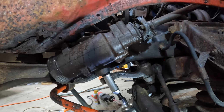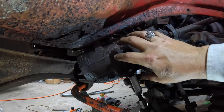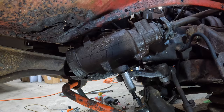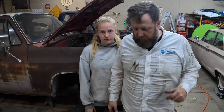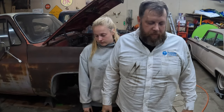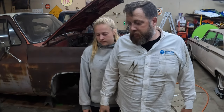I am right on the edge of just unbolting this whole steering gear, pulling it out and replacing it. Well, that's the end of night one for us. A couple of positives - shirt's still clean. Also, we got everything except for the pitman arm off of the steering box. I heated it up well enough that it shouldn't be on there, but I'm probably going to need to replace the steering box now.